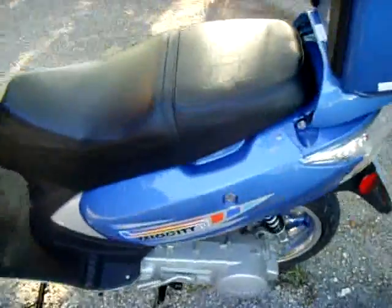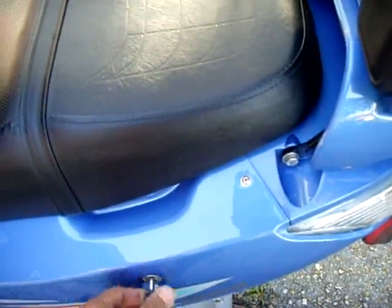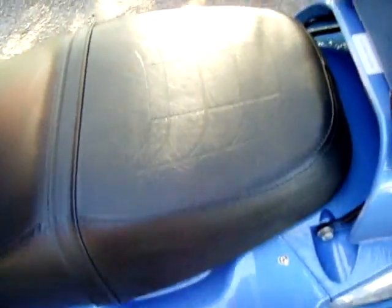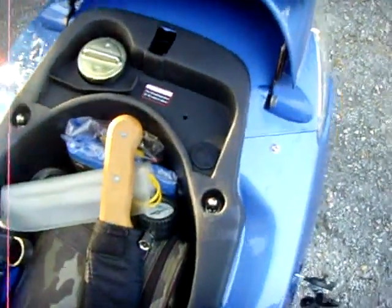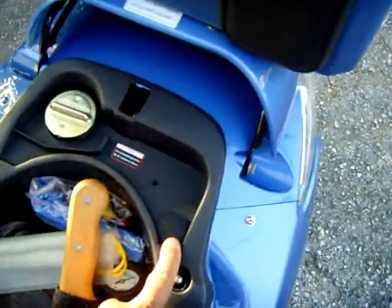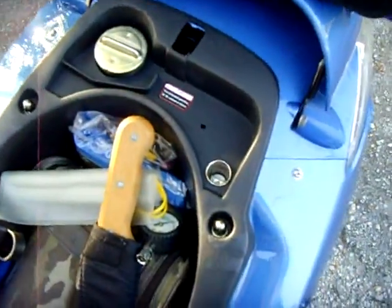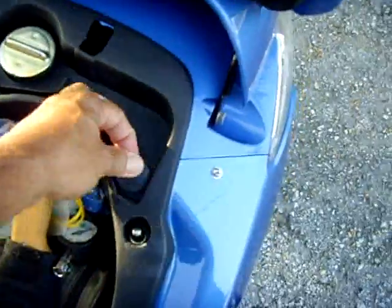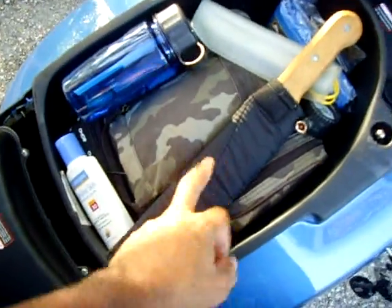I added, let me open this up and show you what I did in here. I have a full survival kit under the seat. Everything in it. You name it, I got it. Never know. Alright. Right here, I added a 12-volt accessory socket. It's waterproof, and it's also hooked up to a 20-amp circuit breaker. So you pull this rubber plug out. I can plug something in, charge it. That's good to go. Rain poncho, electrical tester, full tool kit under here, machete.